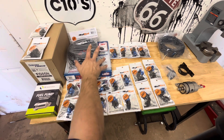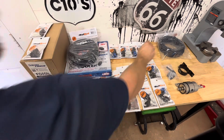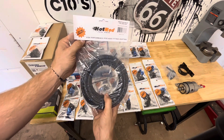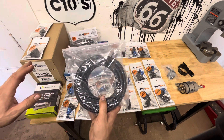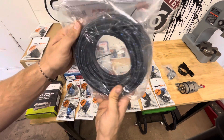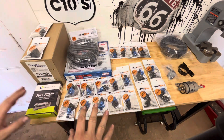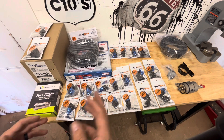This is for the trans cooler — I'll go over that in a minute. We bought the PTFE line; it has a lifetime warranty, ethanol won't break it down, it shouldn't ever leak, and if it does it's warrantied. I got 20 feet of the black with blue checks for the fuel line — looks pretty sweet. These are all the various fittings you'll need to adapt everything from dash-6.